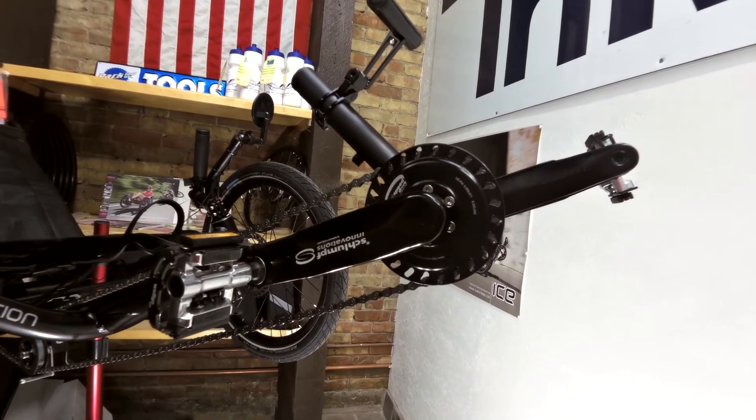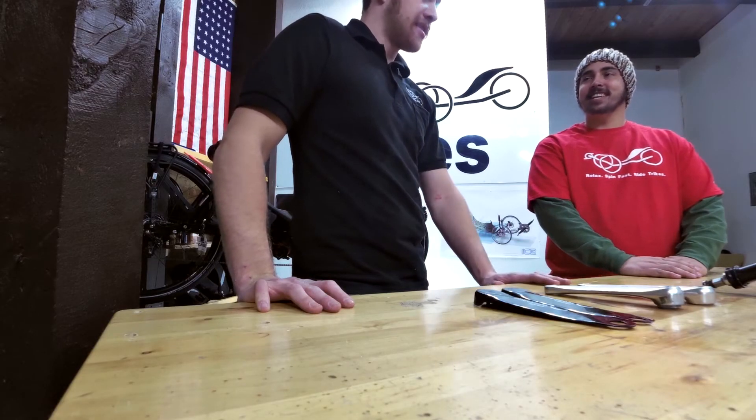That's astonishing. That looks super useful. Yeah, it's a great option for people who don't like derailers. I didn't mention before, but you can shift this drive at a standstill. Should you come down a hill or have to make a quick stop and you're stuck in a high gear, you can click it over into the one-to-one ratio without having to pedal or anything. So really handy in that respect also.